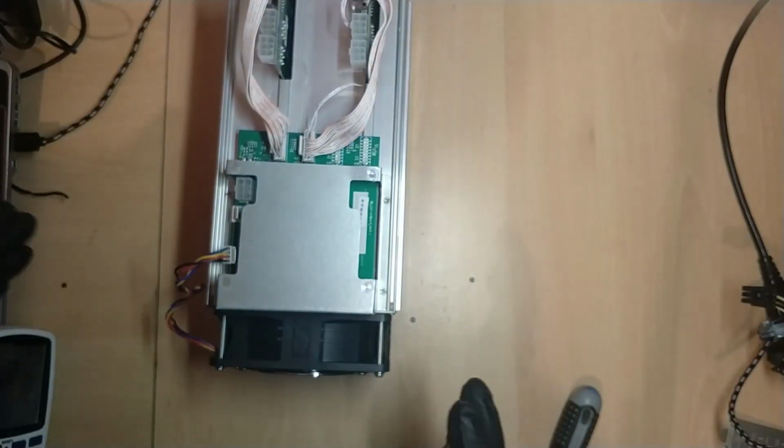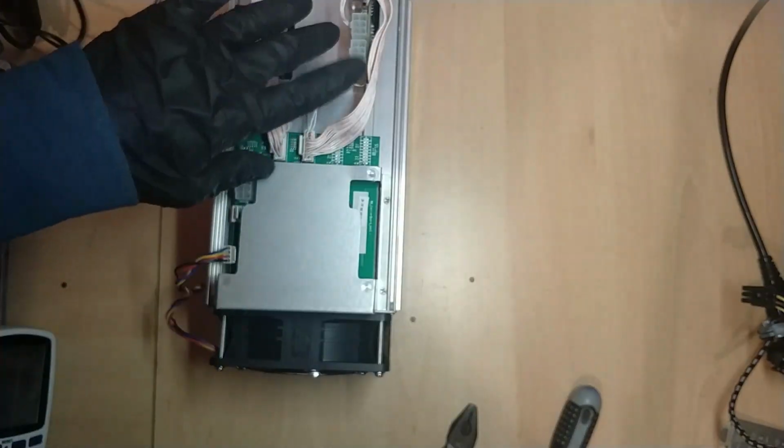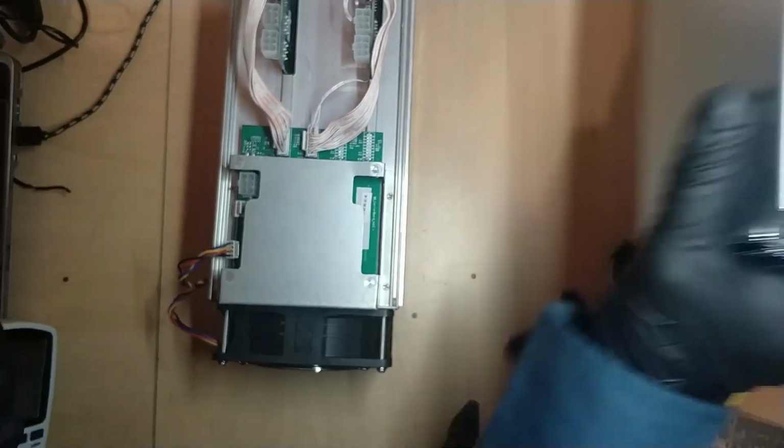So to power this miner, it's spec'd at running at 600 watts, so that's 300 watts per card. Only 5 connections are needed, so a power supply with 10 connections should be fine if I'm going to power up 2 machines, because I'll only need 1200 watts, which does give some headroom for some overclocking if I wanted to. I think I'll use this power supply.